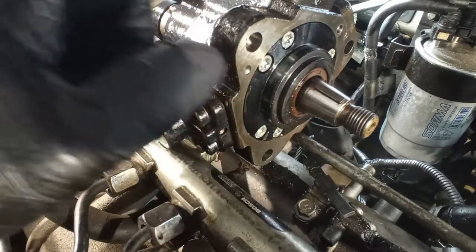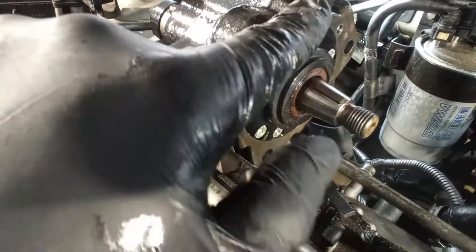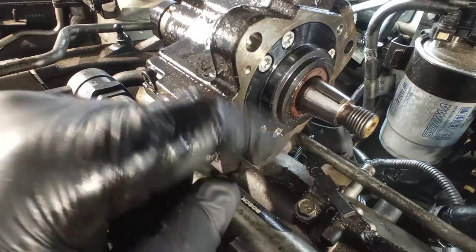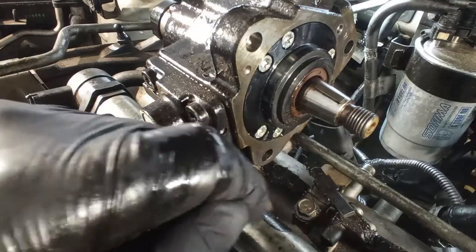The idea is, as you have this high pressure fuel pump synchronized, every time it pumps one of the three chambers, it avoids, or tries to avoid, an open injector, okay? In this way, it provides you with a better start while you are cranking.